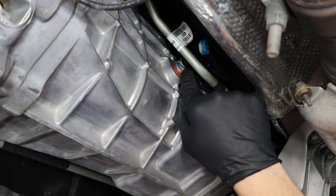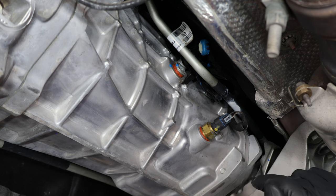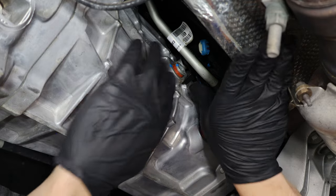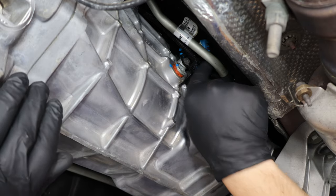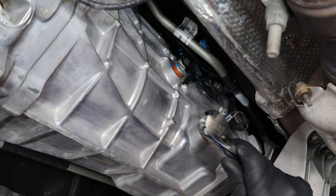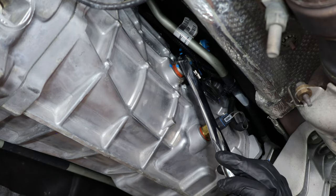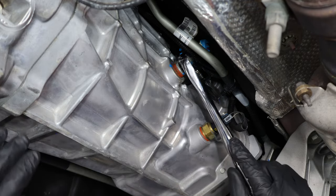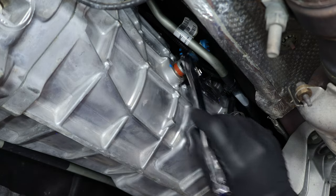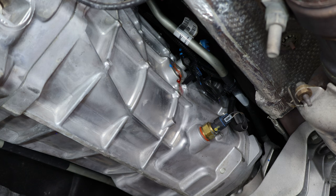The first thing we want to do is make sure we can actually loosen the fill plug, because if we can't, we definitely don't want to drain all the fluid out with no way to refill. To make space, just push the trans line toward the outside of the vehicle — it's on a push pin, so you can easily move it aside and snap it back once you're done. Grab your 3/8 ratchet, insert it into the fill plug socket, and make sure your drain pan is underneath. You can see it was very loose — doesn't take much pressure. Go ahead and loosen it all the way to confirm you can refill, then pull it out. You'll see a little fluid start to drip — that's normal.